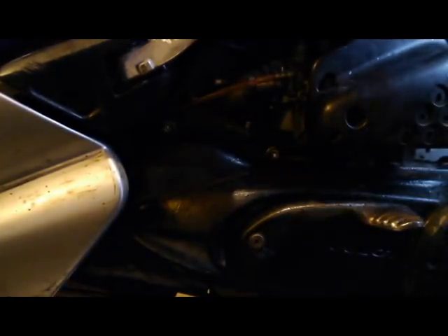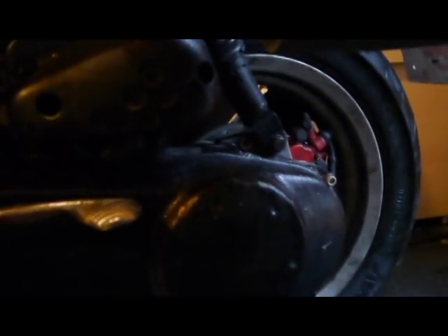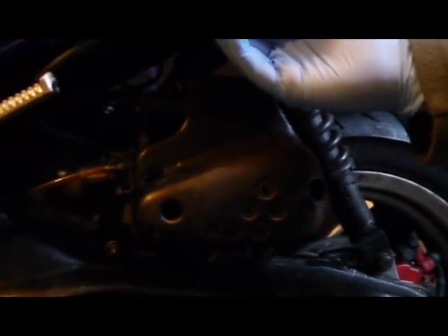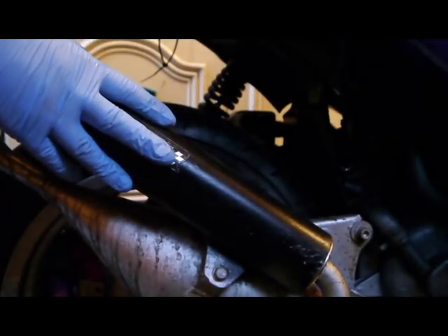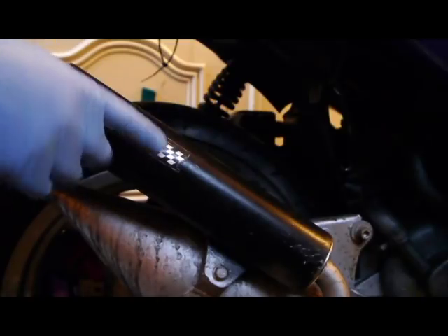These are the vacuum pipes. If they're slightly too big they'll suck in air as well. They do feel nice and not too tight. If you get the wrong gauge pipe you're sucking in air, which will cause problems. We want to go through that in a minute, and of course the exhaust - as I've said, this should not be as noisy as it is.